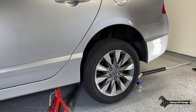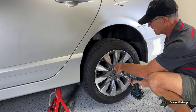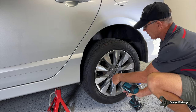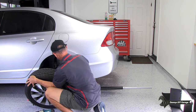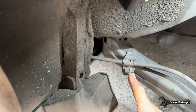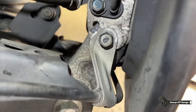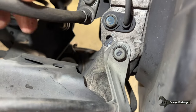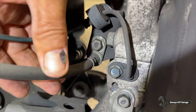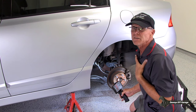My wheel should spin. So let's get that wheel off and start our brakes. So these are the bolts I'm going to take out. This one is the parking brake. And over here, this one is also the parking brake. And then this one here is the brake hose. So I remove these — it just makes things easier for me. Now for those of you that say you didn't need to take those out, it's just easier for me.